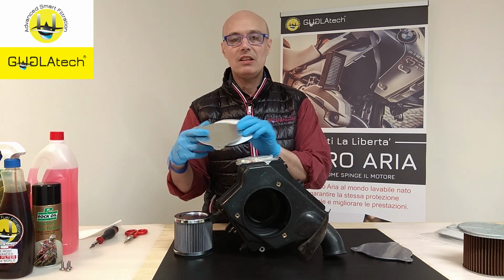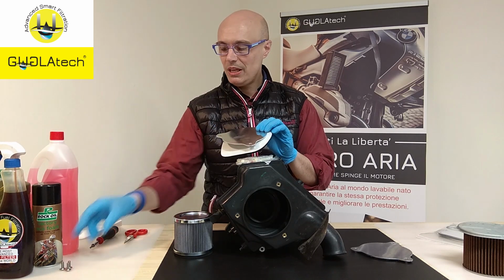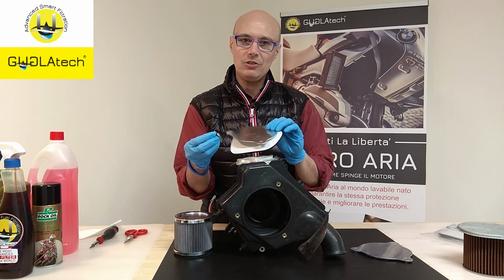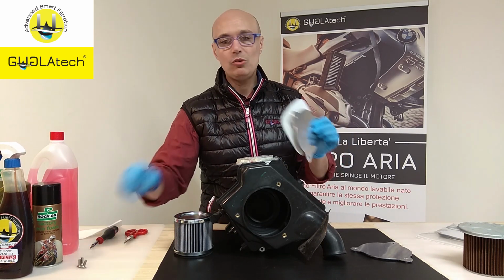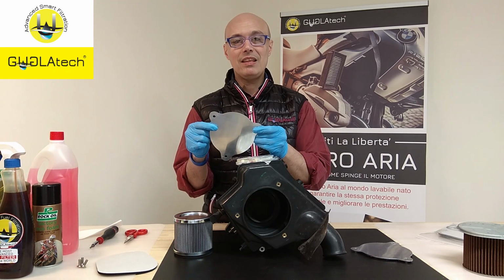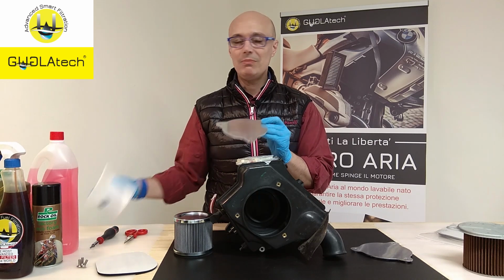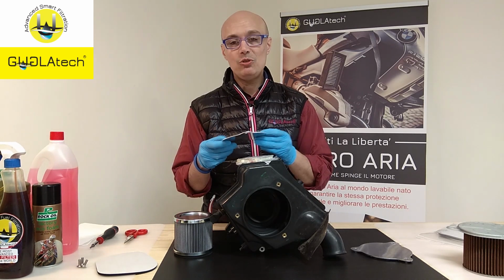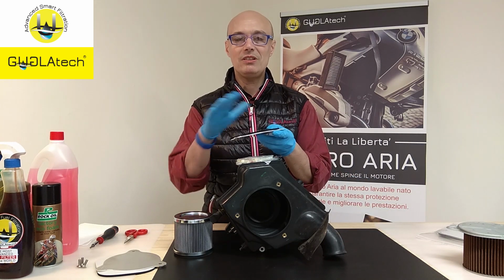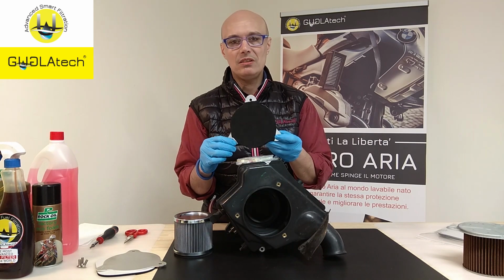You will receive the laser cut beam, the foam adhesive to make the seal at the bottom, and stainless steel screws. We believe that the original ones are too short for the application, so we provided new ones. What you have to do, there is a logo on one side, beautiful, ain't it? And the other one is where you will attach the adhesive foam. Just clean it with some alcohol, paper, that's it. And then I'm sure you will do a much better job than me, simply cutting it and making sure that it's covering this lip here. Don't cover the holes, it's not necessary.